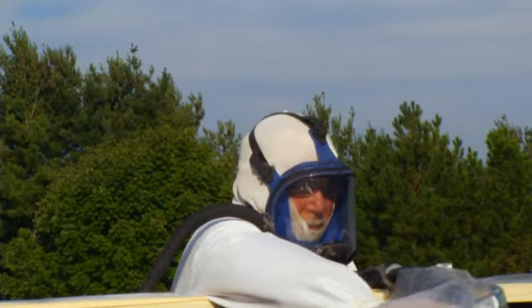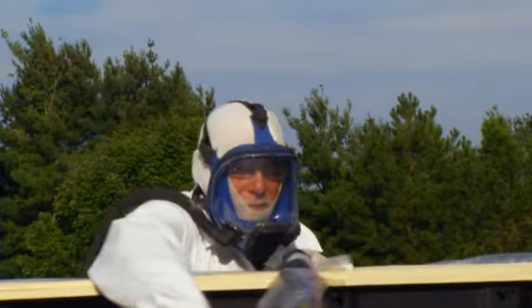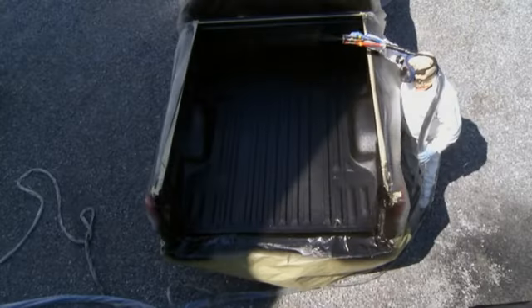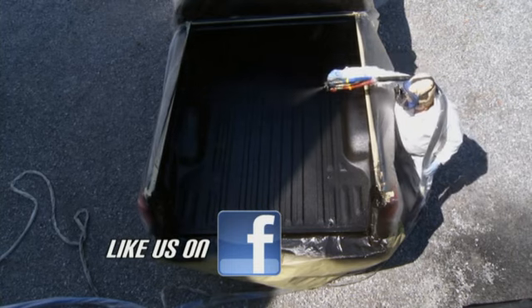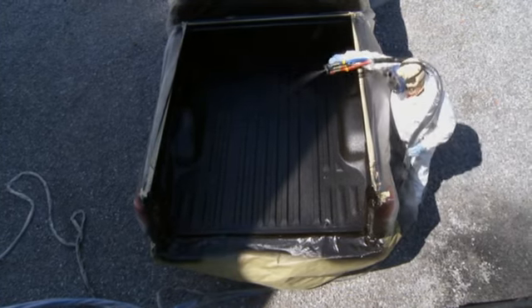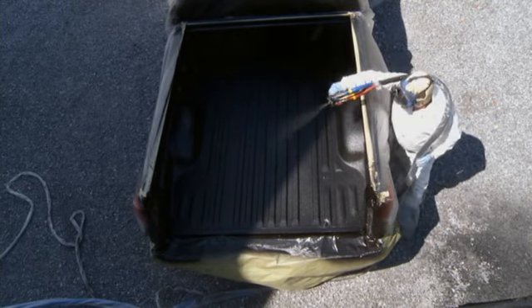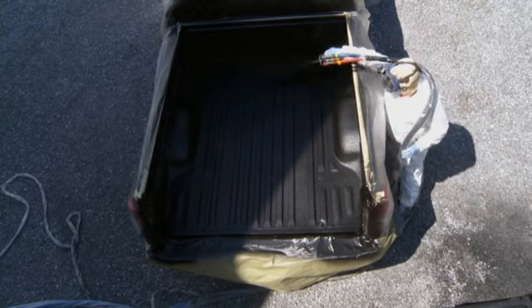There's what's called a texture coat. When you get done spraying the truck liner, you'll have shiny spots, rough spots, and not-so-rough spots. The texture coat goes over it from a distance of five to six feet — you're sprinkling the droplets over the surface. What you're gaining is two things: you're making it all look the same, and that's where you get your slip resistance.